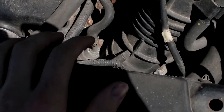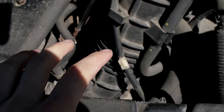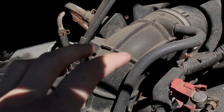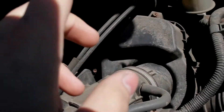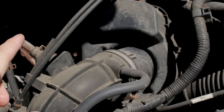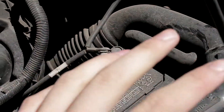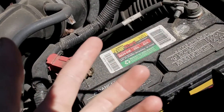So what we're going to be replacing today, and first pulling out, is the air box. Take off the mass airflow sensor, all the tubing and everything else. Removing some bolts in the back of this box — I'm not sure of the size, but we'll get there. And then removing everything else. I might even take out the battery just to have some extra room.